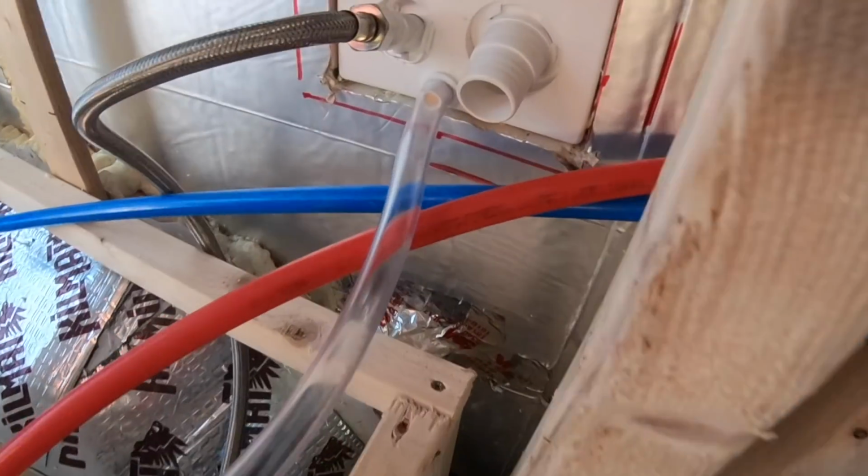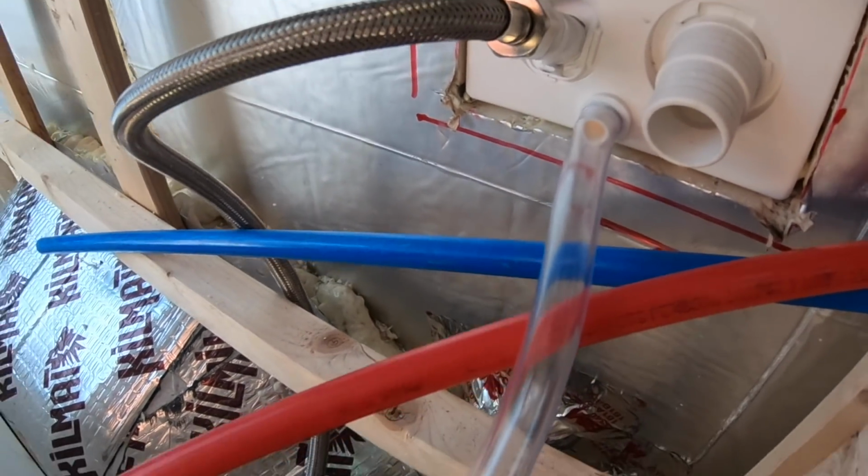And then the 1/2-inch hole on the bottom was our feed line, the supply line, so the water would come out of there. And then the 1.5-inch would be our fill line. We hooked up a big 1.5-inch tube, which you had, maybe it was from the pool or something. And so we had a basic idea, and one of the things we didn't think about before going into it was having a 3-way valve, like a ball valve.